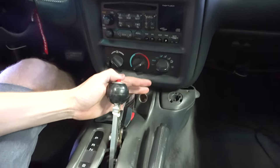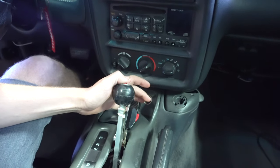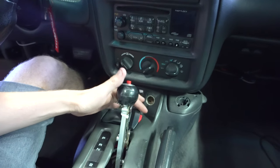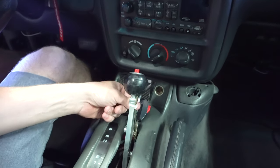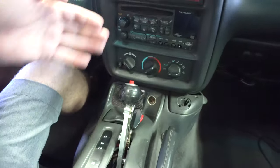Still super happy with the car. I've since came home and fixed the bump button — let me show you guys. So this is how I have it set up: trans brake on bump in. If this sticks on — if you hold it on or if the button malfunctions and sticks — it has a predetermined time in the bump that it will just keep activating and bumping the car in. Unfortunately that's a turbo car issue, but it's fixed now. All's good and on to the next race. Thank you guys so much for watching another episode of Built In Race — if you haven't yet, please hit that subscribe button and we'll see you in the next video.